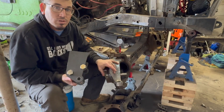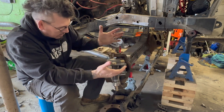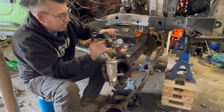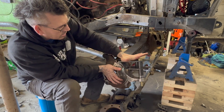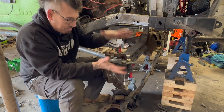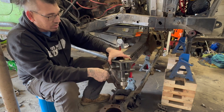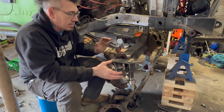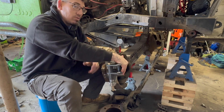Now that I've got the knuckle all drilled out and ground down, we just got to drop the high steer arm into place. The biggest thing you're looking for is to make sure it sits back against that key slot — there's a little notch right here. You also want to make sure the top sits flat. As you can see, it's not hitting anything and it's not sitting crooked. I used one of the DOM sleeves in the position I might be running the drag link, and that's for spacing — I want to make sure nothing gets twisted.